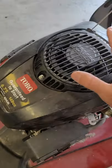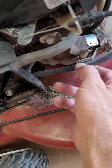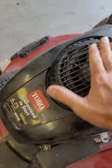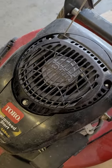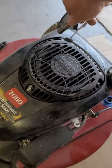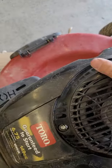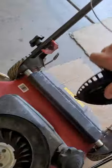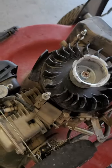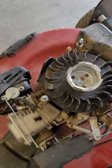What I want to do now is take this cover off so we can have a look at the top side and eventually gain access to the carburetor. We'll unhook this fuel line — I think this is a vent line for the fuel tank itself. Let's take off this top cover; it's ten millimeter nuts. This one's only got two, so clearly someone's been in this before — probably not another good sign. These are 10mm, and the top part will come off like so. Be advised: you've got some little standoffs here on these studs. Sometimes they get stuck to the covers, so if something goes flying and you didn't know what it was and it looks like that, that's where it goes.